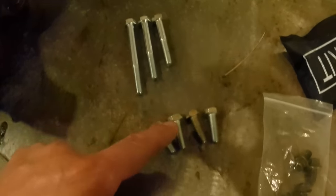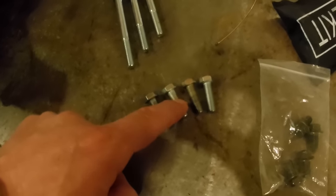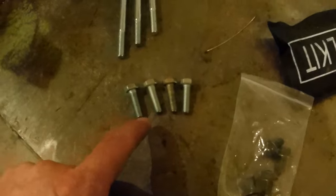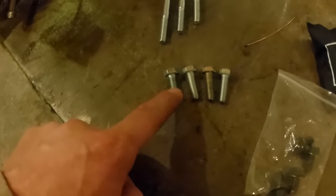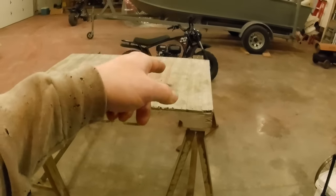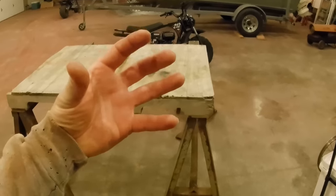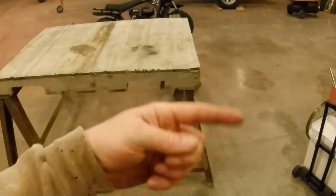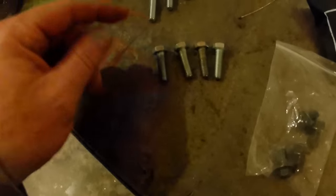The other thing that they don't tell you on the website, and I only learned beforehand by watching that video that I'll link down in the description, is you need more 5/16 24 bolts to mount those plates on the side of that Predator engine, the plates that attach the jack shaft cover, that whole clutch assembly, that big plastic cover. So you need 5/16 24 bolts to attach that. I went ahead and got an assortment because I didn't know what length I would need.